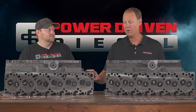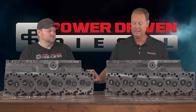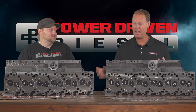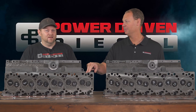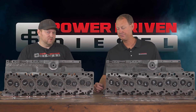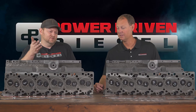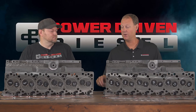On ported heads, o-ring or fire ring for sure. I would not put it on my truck without one, even if you can't afford head studs — even with head bolts it's still worth it. If you had to put it back on without studs, at least do the o-ring. Pulling a head off and on is a big chore with the right equipment, and your average local machine shop may not even know what an o-ring is. So if you're ordering a ported head, do minimum an o-ring or a fire ring depending on how aggressive you want to go.